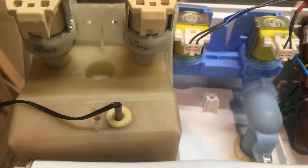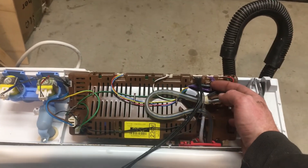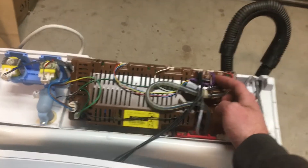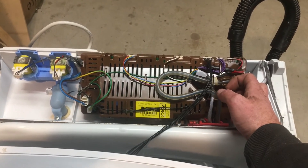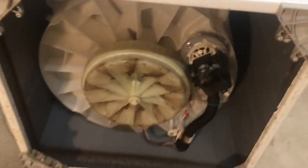You can also have leaks from the inlet valve stem, but that's a bit more rare. While at the top, I can see we've got purple wires on the RPS, so I already know it's a Phase 7 or 36H RPS sealed type but with the unsealed wiring harness — it hasn't been upgraded to the fully sealed RPS yet. But they're definitely better than the original non-sealed PCBs. Next we're going to tilt over and have a look underneath the machine.